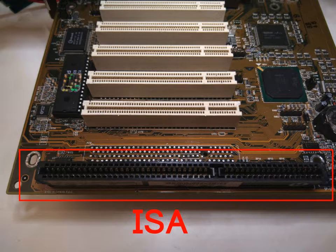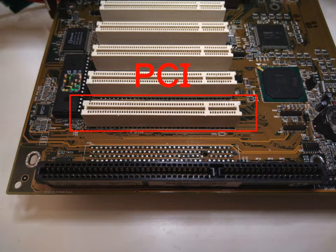Well, all of this is specific to the ISA bus. The PCI bus works differently and its interrupts and DMA are not compatible with the ISA ones. So all software designed to work with an ISA sound card won't work with PCI sound cards. PCI sound cards therefore need to implement some compatibility techniques for DOS audio to work.